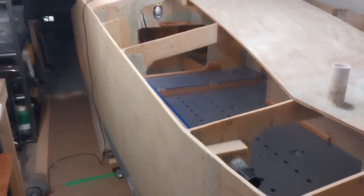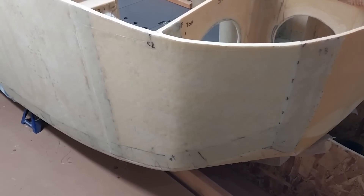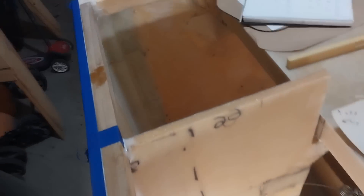I've had good motivation lately and so much progress has been made. The outboard forward portion of the side panel was fiberglassed, and of course the inside of the bow as well. Back here at C2, on to frame C3, C4 through C5, back in the aft cargo hold — all these seams are done as well, C6 and in the back there, the transom.